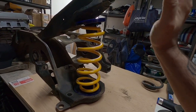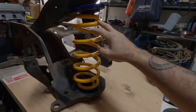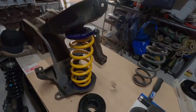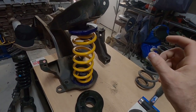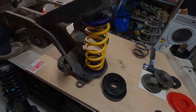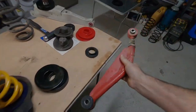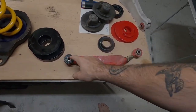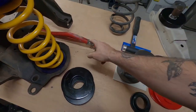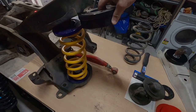As you lift the Territory the top of the wheel comes out, so to fix the camber you might need an offset bush. At basic lift it's not too bad, but once you start adding extra spacers you're going to need extended shocks. I use Navara shocks with some adapters I make. I also use adjustable camber arms - I've tried poly Pro ones but the bush still stretched, so I now take standard arms and strengthen them since they bend. You'll need something like that, or offset bushes, for extra lift.